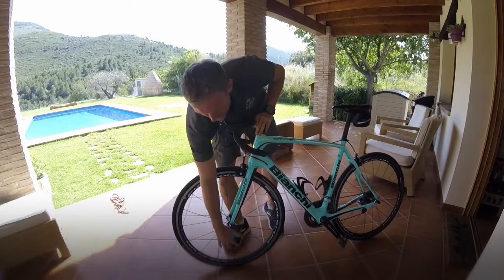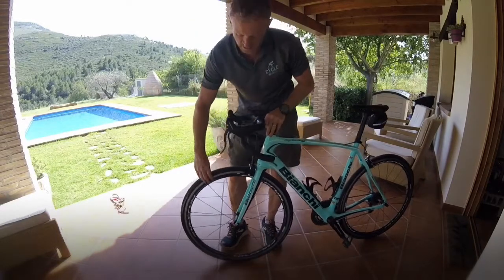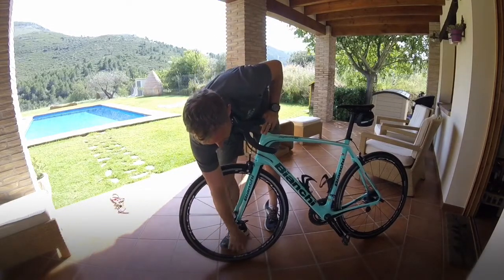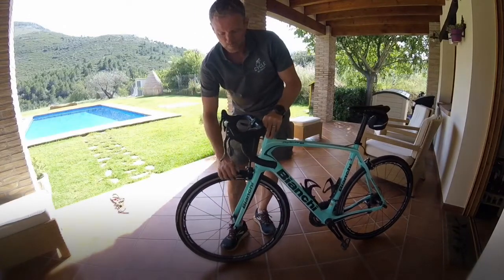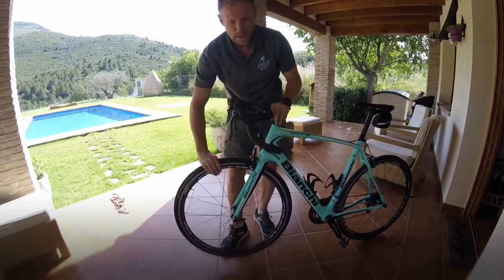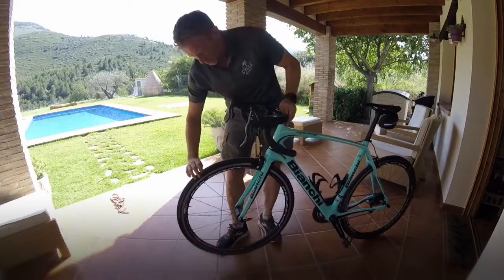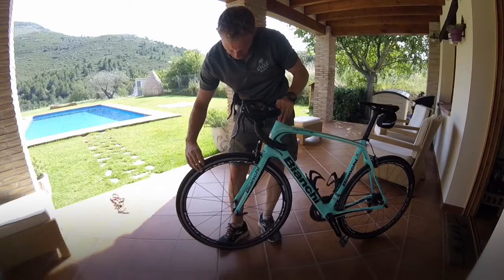So now we're checking this area, so check your wheel. Is it spinning freely? Yes. How are the spokes? Are they all tensioned? All feeling fine? Yes. Is the wheel wobbling? Is the bearing fine in there? So just grab your wheel, give it a shake, it should feel nice and firm. So we're happy the wheel is fine, there's no blisters on the tyres, the tyre isn't worn, so check the tyre. Any cuts, any blisters, anything worn on there?